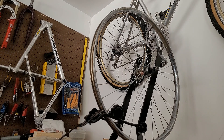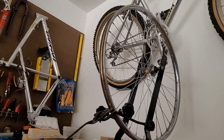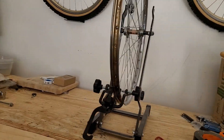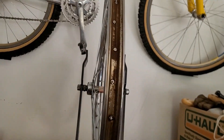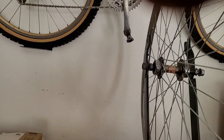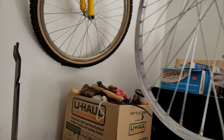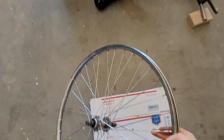I've been tightening these spokes down a little bit at a time, going all the way around side to side, getting it really even. It's pretty close and in a good spot. The next step to get this wheel ready to go seems a little unconventional, but the first time you take a new wheel out on the trail, you can easily knock it out of true again.